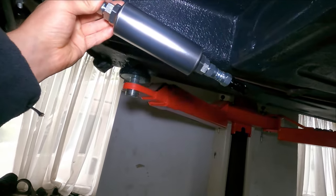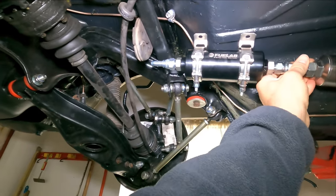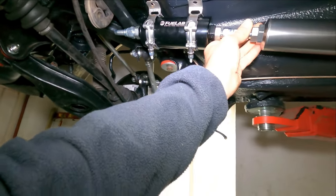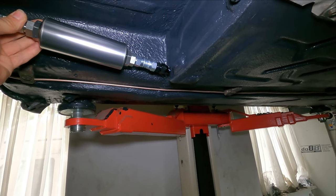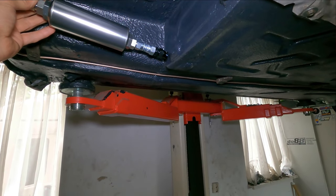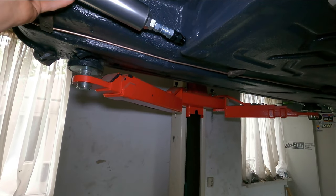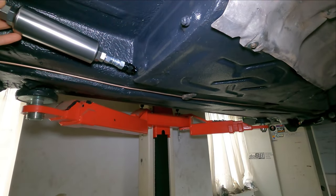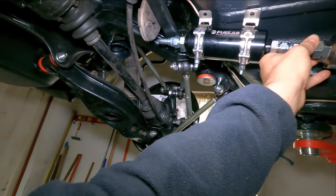It will be mounted here on an aluminium plate. You can see it sticks a little bit out. From here I can just move the flexible rubber line upwards through to the tank, and then there will be the inlet into the car. Then I will run the half-inch aluminium tubing to the front inside the car, which means you have less problems with corrosion. Some people think it is strange to run a fuel line in a car, but I think it is no problem - I did it also with the V12.